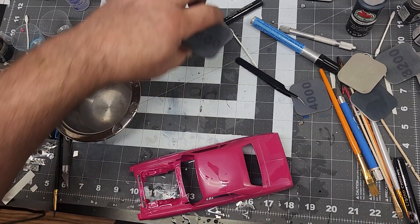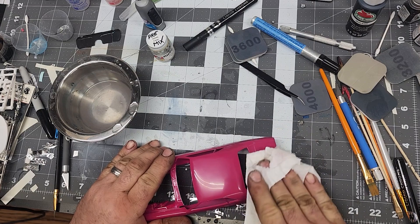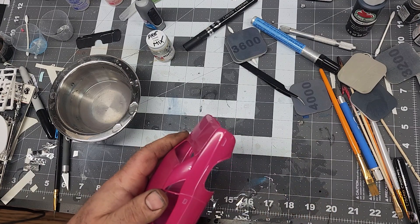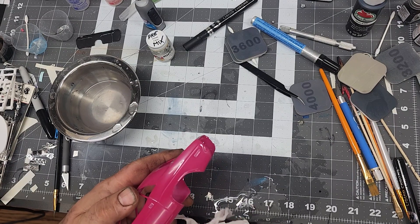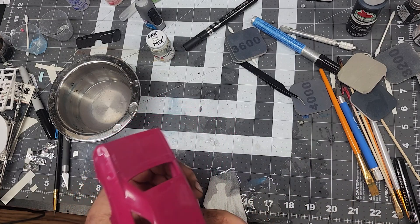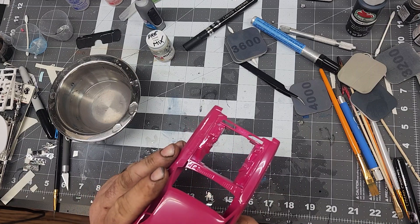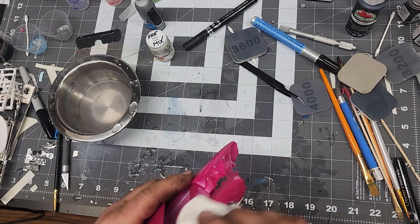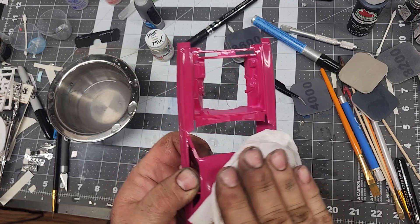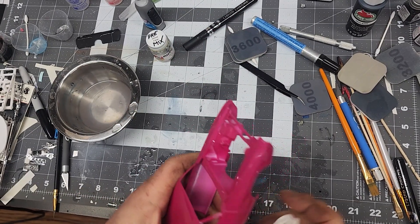Alright, we got it cut down. I didn't want to go too crazy — I can see I'm getting just a shade thin in spots and I really don't want to have to respray. I started with 3200, went to 3600, then 4000, and didn't go crazy on the sides because there's a lot of body line I didn't want to go through. My dust spots are pretty much gone. I did hit it with the 12,000 a little bit and just wiping it with a damp towel you can already see the shine starting to come through.